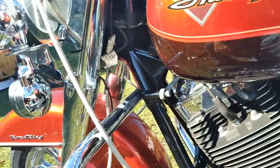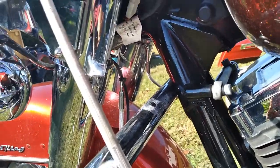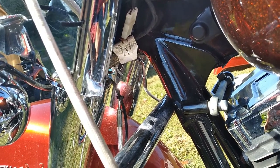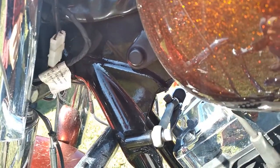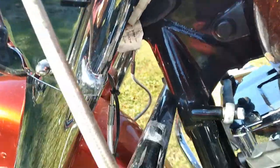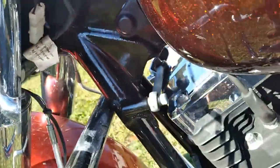And your neck bearings, if you've got a Zerk fitting on there on these things, don't overpack it. I've had guys run an entire tube of grease in there, and then they're driving down the road in the summertime and grease is flying everywhere, and they think they've got an oil leak. The entire front of the tank could be coated with grease that's gotten hot and just flying back.